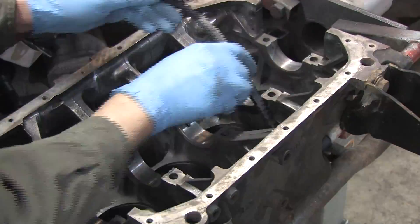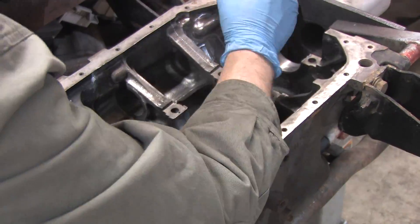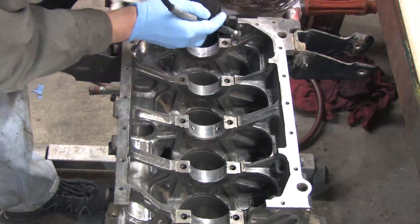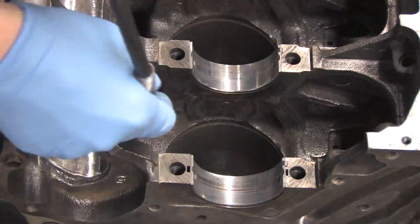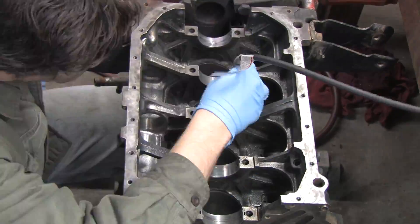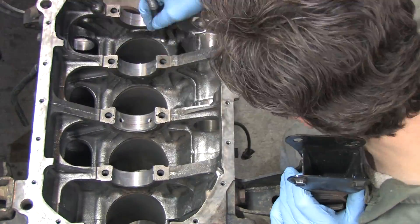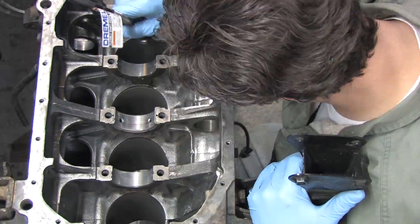That's enough horseplay — this thing's basically done. I'm just going to clean the rest of the rust out of the corners with fine wire wheels and a Dremel, then wash it out one last time with mineral spirits. These are the tricks you can do to your engine to improve oil return performance: smoothing and channeling. Unless your crankcase has a terribly cast, blocked-up oil return, your average stock car with a stock oil system is really not worth the effort — you can stop at just cleaning it.